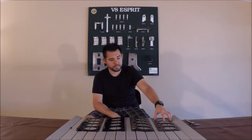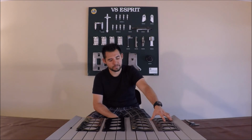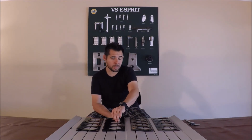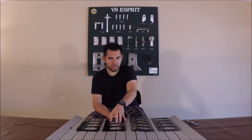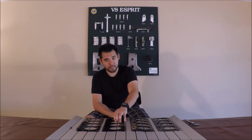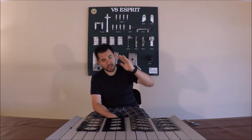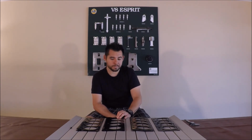There are no issues with them as long as your surface prep is good. Unfortunately, they're getting very difficult to find. So does that mean that there are no good options left? Not quite. I think that these aftermarkets can probably still work. You could get rid of the height difference between the top of the sleeves and the top of the block, and I think you should be fine.